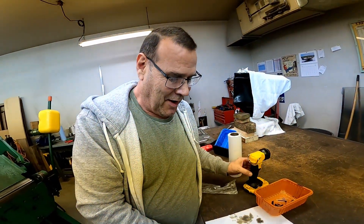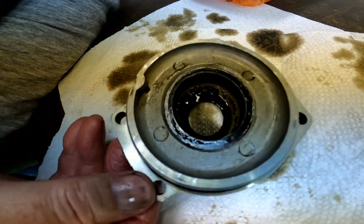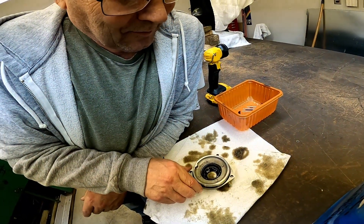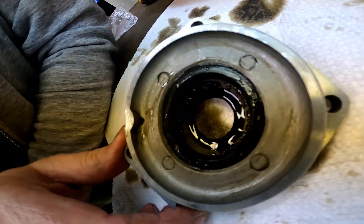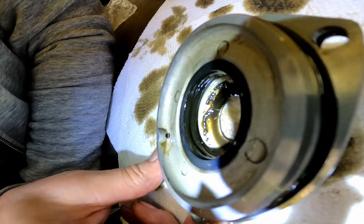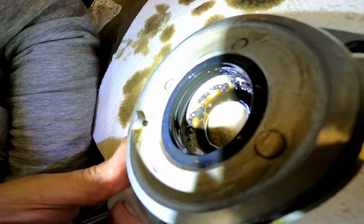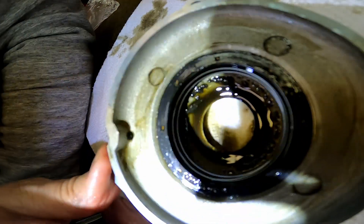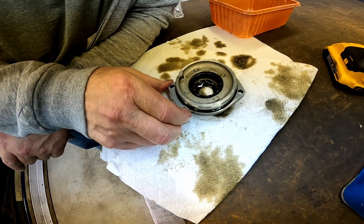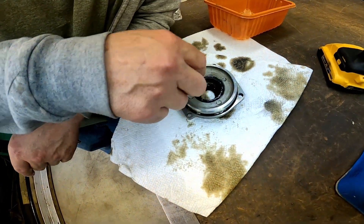This is your lower main bearing end cap, sitting right there. So there's two seals right here, back to back, lips facing down. And you can see that right there — that's all rubber debris that has worked its way through the seal. That's why most likely it's partially leaking. There's a little bit of grease, but there's rubber mixed in there. You can feel it in your fingers when you touch it. It's somehow working past the seal.